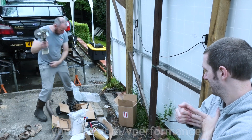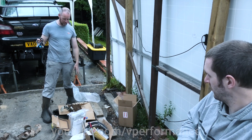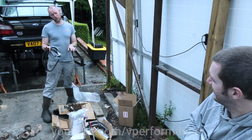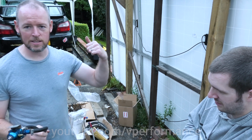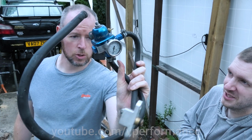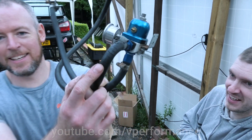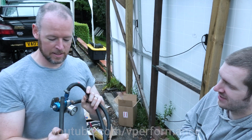Cool. Okay. Also on the survivability front, David, again, MB Developments. Basically, if ever I want something and I don't have it, I just mail them. And I was like, hey, got any fuel pressure regulators? Because Scott had said, get a fuel pressure regulator, because the injectors on this are almost maxed out. Standard WRX injectors. This is a Fuel Labs fuel pressure regulator with the gauge on it. Second hand, again, so I got it for like 110 quid. World's nastiest hose. It's not great hose. This needs replaced immediately. But it's suitable for unleaded. That's the main thing.